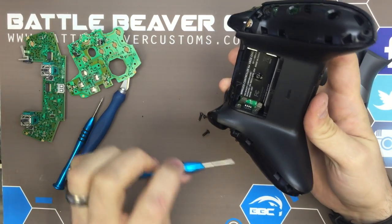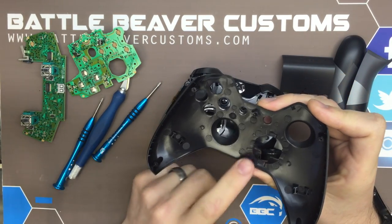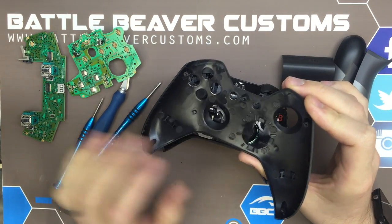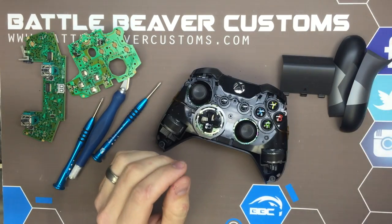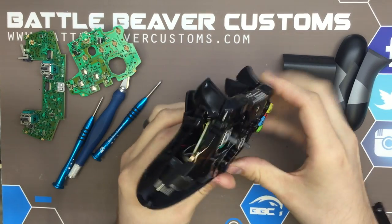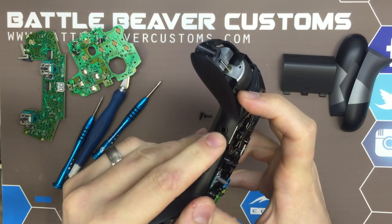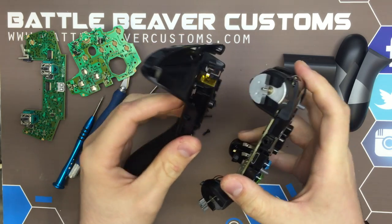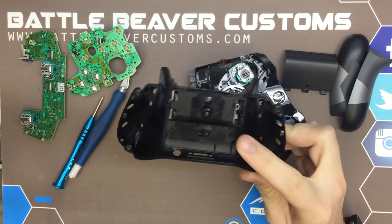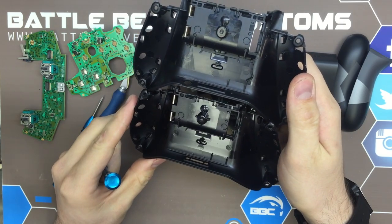So they're long overdue to do this — this is what PlayStation has done from the beginning. We'll lift off the faceplate and turn this over. Everything on the faceplate as far as markings are concerned still looks the same, so our replacement parts should be safe there. Thumbsticks are still the same. Pulling this mid-plate out, it looks like the mic port actually bevels into the controller right here. The rear shell has a new bracket and a new connector at the bottom. Comparing it to the old one, you can see the addition of that support structure.